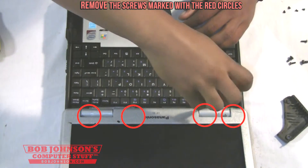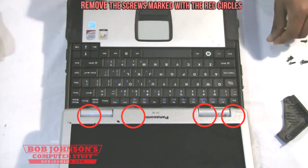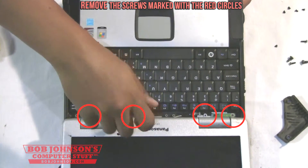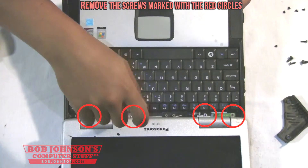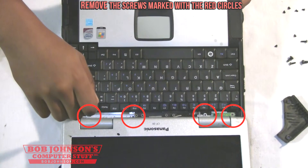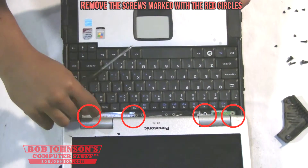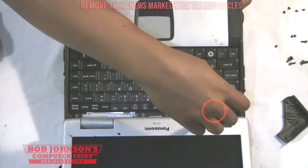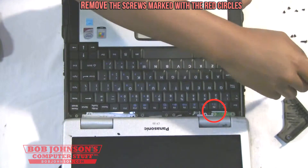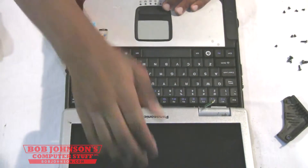Now what you must do is open your display once more and remove the hinge covers from the Toughbook. The hinge covers are held down by two screws each. We're using a regular Phillips-head screwdriver once again to do this — it just requires a little bit of force. So keep working at it. Once you've removed the screws for the hinge covers, you'll have to remove the screw for the Bluetooth, which is obstructing one of the hinge covers themselves. Remove that screw and sort of peel back the Bluetooth, bending it back so that it's not in the way.